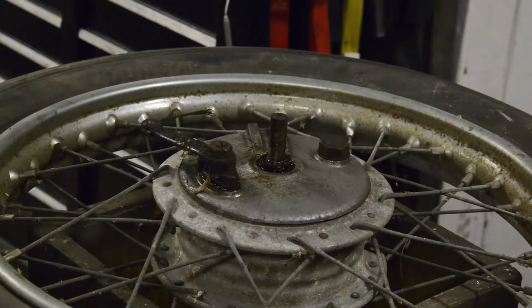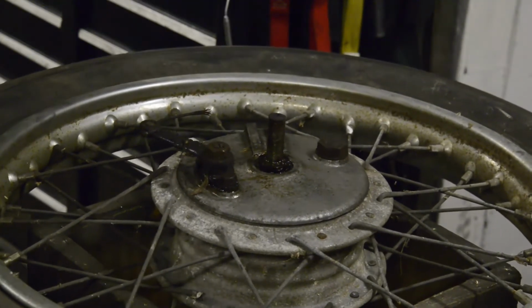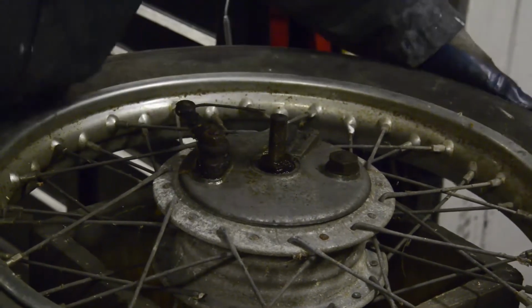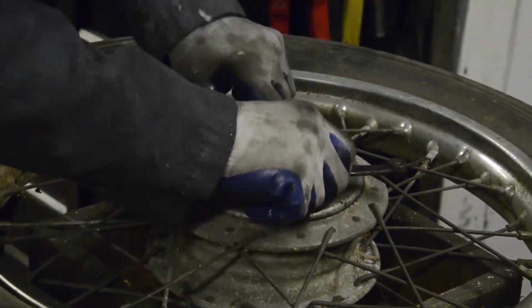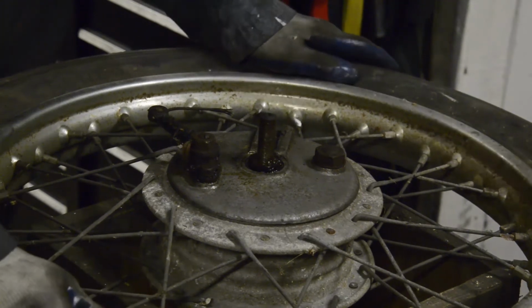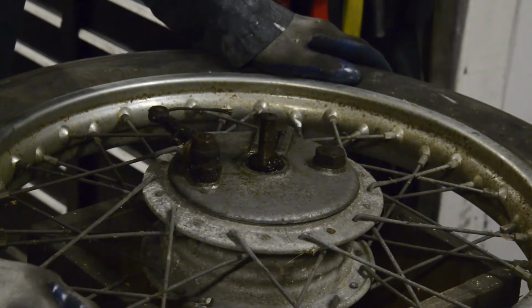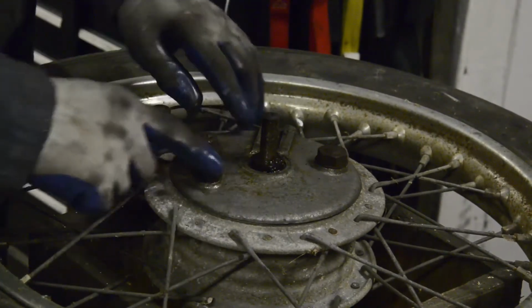We'll start with the front wheel, and this actually won't take long because very much a wheel's a wheel's a wheel. But this one is slightly unusual because we've got a brake plate on this side, 6 inch, and we've got a brake plate on this side. Now, oh, that was solid. For those of you old enough to remember the days before disc brakes, on some of the GP machines, there were some very exotic drum brakes. In fact, you would get things like four leading, I'm trying to remember the name, it'll come to me. You would have four leading shoe brakes.